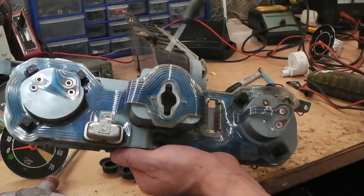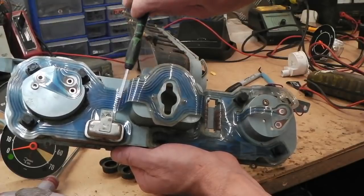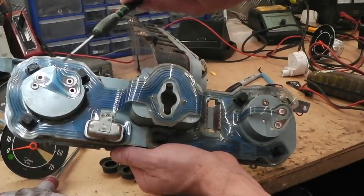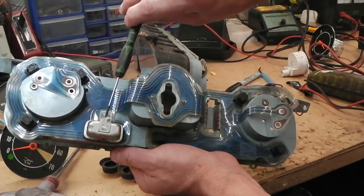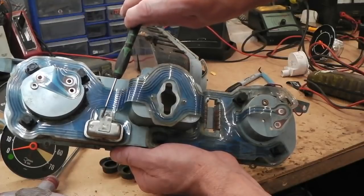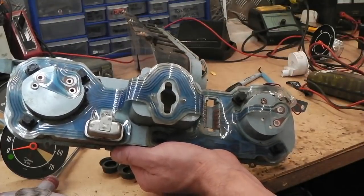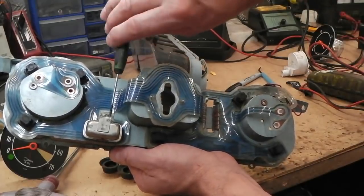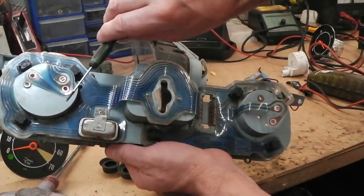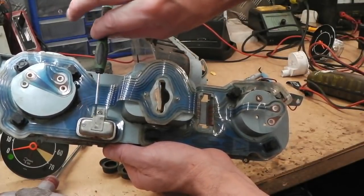In other words, they've never got 12 volts. It's pulses of 12 like this, just ticking at the gauge. So the gauge never really has time to wander around in a big way. This gives it a more slow movement and regulates the electricity to the gauge so that it can never really fly about. It requires this to keep pulsing it. Now you think that might make the gauge jump like that, but because the bimetallic strip takes a while to cool, it doesn't actually pulse.